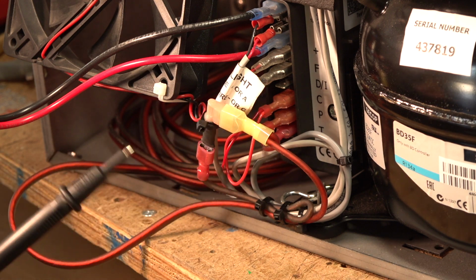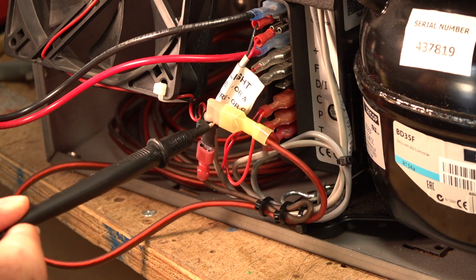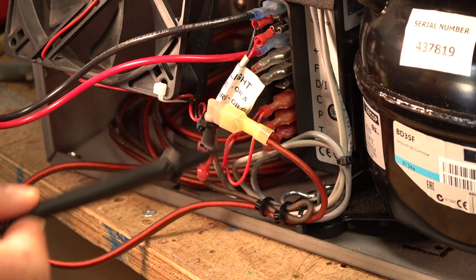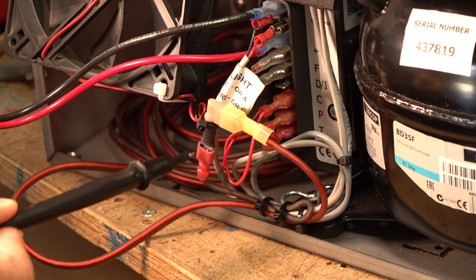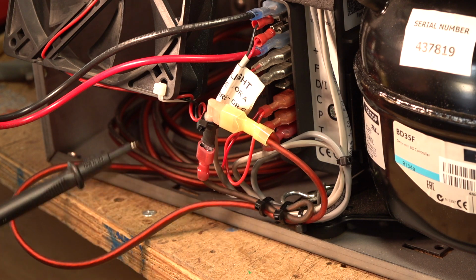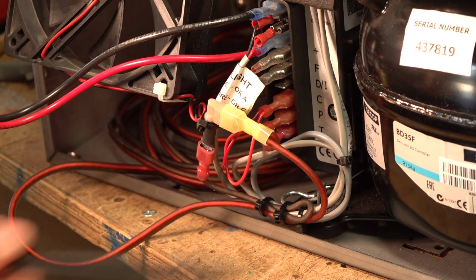its medium speed. With the switch closed, there is a 0-ohm resistor, basically because this cable then bridges this resistor with 0 ohm, which means the compressor will run at its lowest speed. So this gives me the switch to control the compressor speed.